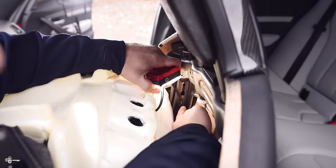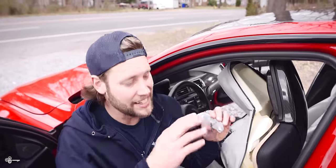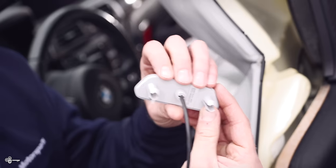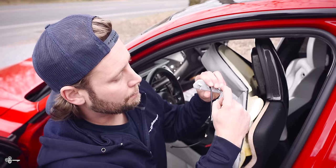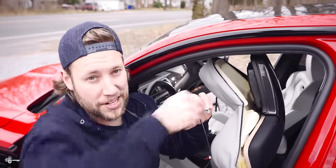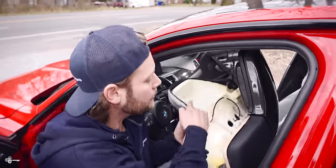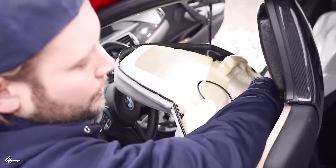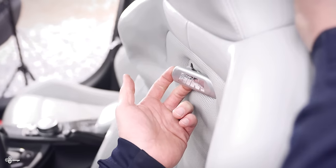Over here there's a little connection. Basically, what you're going to do is push in this little tab right there, and that's going to slide up just like that. Now, the next portion is going to be very difficult to show, but I'm going to do the best I can outside of the car. Right now it's only held in by this clip and this clip. What I like to do is grab it from the outside — you're going to grab it from this side here, then stick your finger in and push down one clip to get it undone, then press up on that clip and pop that side out. Then do the exact same thing on the other side. I'm going to apply outward pressure. I got the one clip out, and there's the second one. As you can see, I have half the badge out.